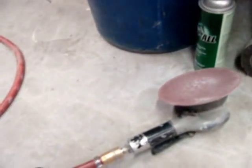I put a layer coat down right in here, let it dry for like 15-20 minutes, then I hit it with this door block right here with some 80. First I took my DA with some 80 on it and smoothed it all out. I got a few little problems right here — looks like a low/high spot right in here, looks like I need to take this next coat out a bit. I've sanded it all down and it's starting to shine real good here. I know I got a low spot right in there — I'm going to hit it with a little more mud, give it another good coat, let it set, then hit it again.